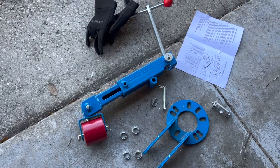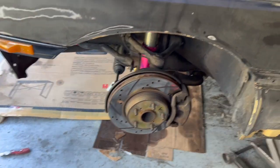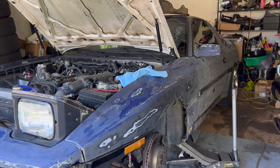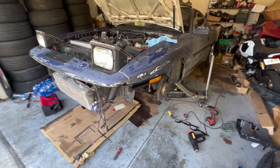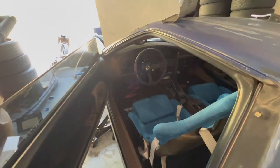Just kidding on rolling the fenders this video — ordered the tool online and it's missing pieces, so can't do that. I went ahead and fixed the spring. I ended up going just a quarter inch up instead of half inch because the quarter inch was already getting tight. I also had to top off the oil because I have a stripped oil pan bolt and it leaked out a lot. Oh, and check out my new carpets — they're really cool and they're gonna match the theme, so you can probably already guess what the car's theme is going to be.